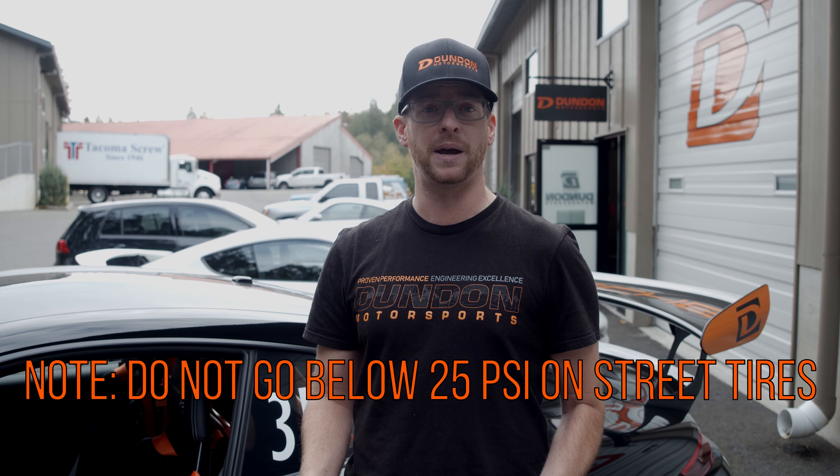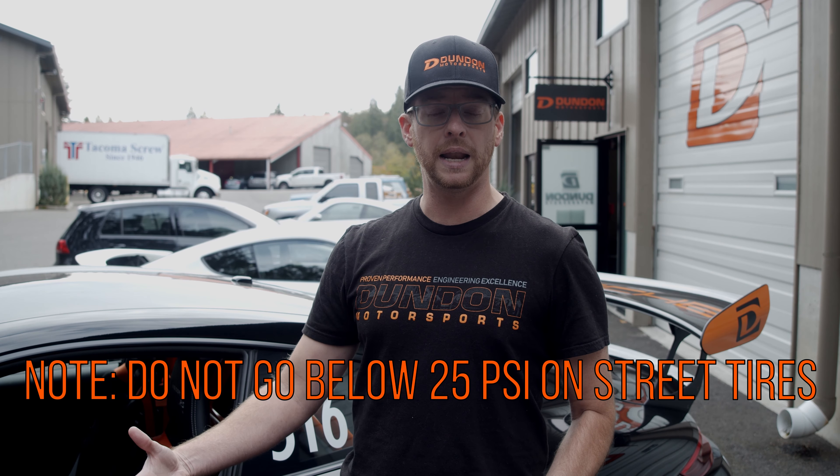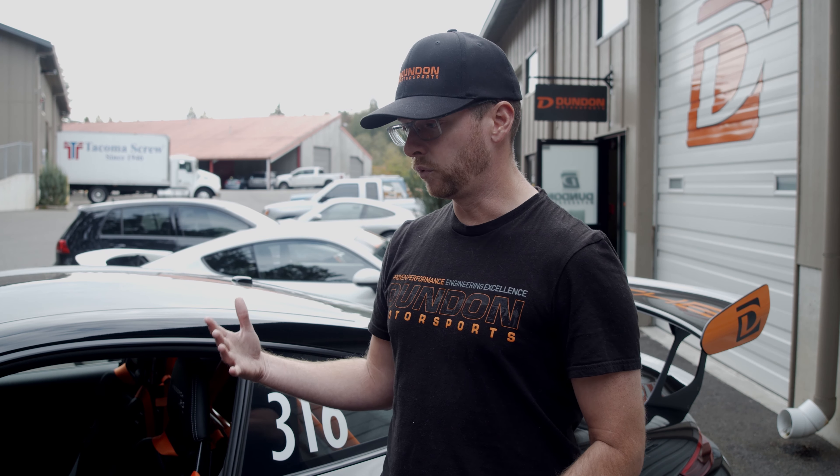So we're gonna start by aiming for that tire pressure once our tires are up to temp. Your tires are naturally gonna grow as you're driving aggressively and they come up to temp, so we're gonna need to drop some air out before we go onto the track. I usually start with a couple pounds if you're a new driver. If you're an experienced driver, sometimes the drop can be up to ten pounds before you get any temperature in the tire. It's really important to check after every session where your pressures are at.